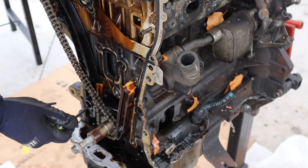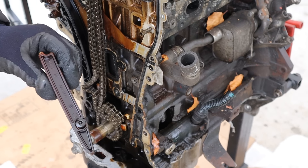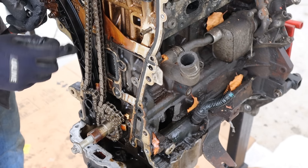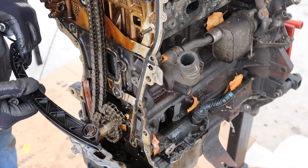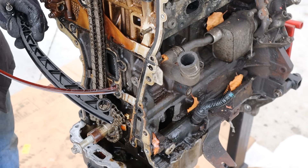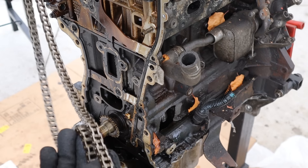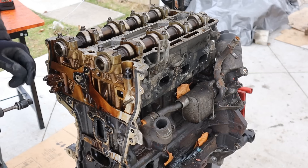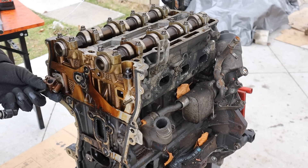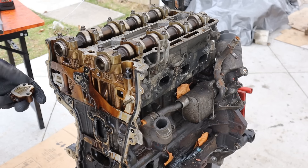I'm just going to pull off these timing chain slides here. That's what's left of this timing chain slide. Pull off that slide — this is the backing part. I don't know why they keep making these out of plastic. This is the actual friction part that slid down. I'll just pull off this chain — at least this didn't get damaged. This used to be the tensioner. Looks like it's a hydraulic tensioner — I can see a hole inside of here with this oil gallery that feeds it.